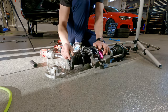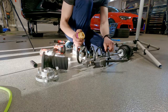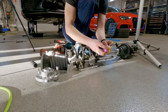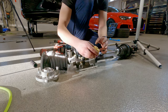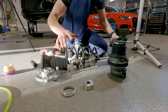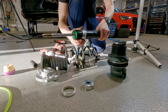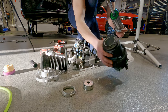Some companies recommend cutting the bump stop. We already cut the other side, but I saw a company mention that this bump stop was actually designed for cars that are already lower, so it should be fine if you leave it uncut. We're cutting it just to be symmetrical. You whack this off, take that collar out, and slide the lowering collar on, which brings the perch much lower.